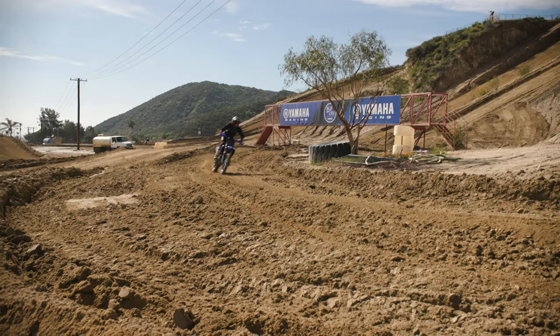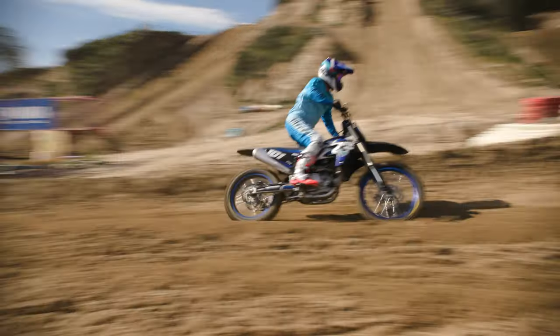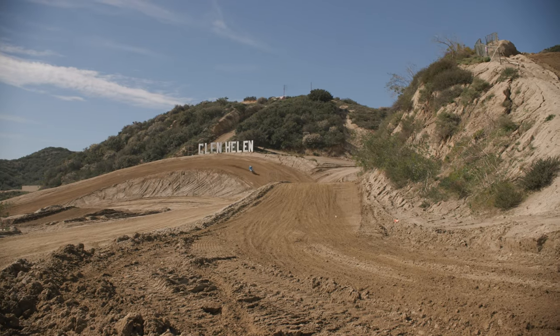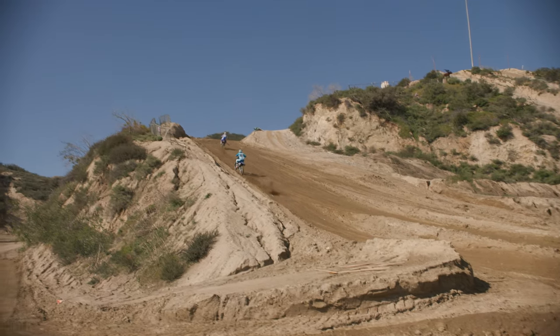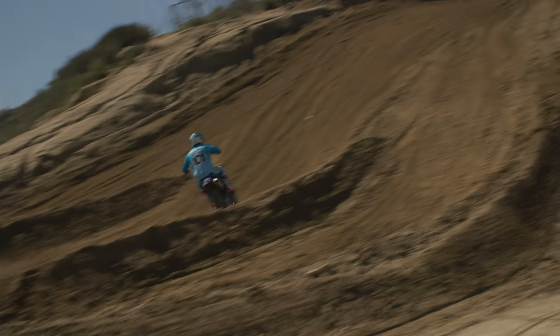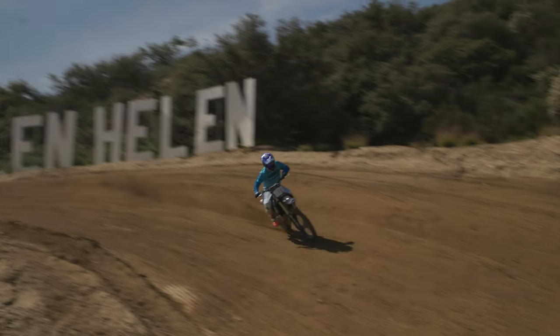To recap everything and what I felt confirmed on the track today: we started with a 14 rear and 33 front. The track was nice and soft for the starts — it's a no-brainer, the 14 accelerates better in a straight line, it's not even close. You just have to weigh that with how hard the track is getting. Are you willing to give up a little bit of that spin on the hard shiny stuff to get the start? Can you run the cushion and find wider lines? That's what you need to do with the 14 if you're going to run it all day. When conditions go more toward hard pack medium it works great — a lot of stuff on the side of the tire works just as well as the 33 — it's just in a straight line it can't bite in as deep and spins a little more.